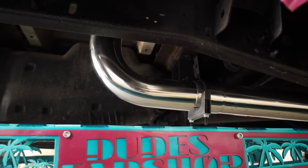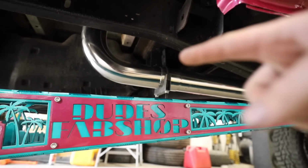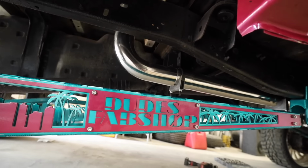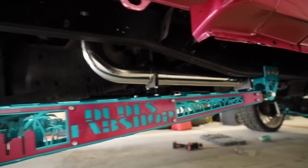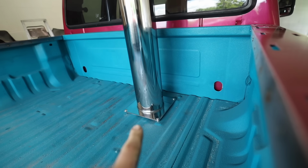Obviously, over here, every time I stack a truck, I don't use flex pipe. I hard 90 them all, and yes, we did get a stainless one as well. So everything's full hard pipe all the way up. Don't use flex pipe there. Make it an actual exhaust kit. And obviously a 7-inch bed stack, 4-inch inlet down there, bolted down.